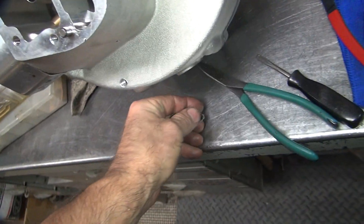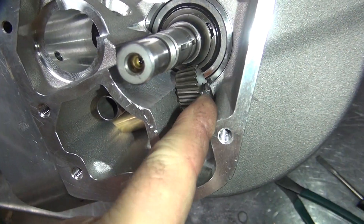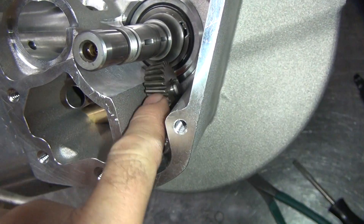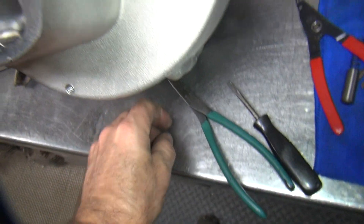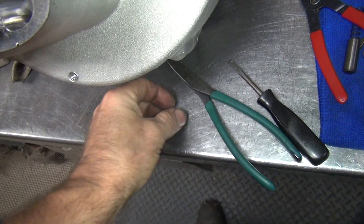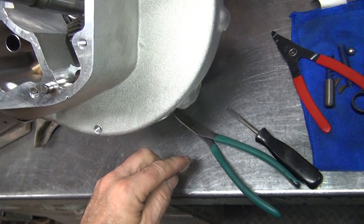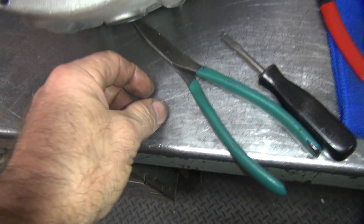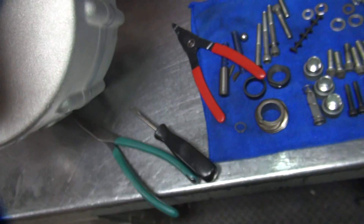So here's another clip. We're going to show so much this time. I'm going to try to put it over the top of the shaft there. We're going to rotate this 180 over. So this groove will not be what the keyway is. Now a lot of times I get this to pop on about halfway, and then I'll use my screwdriver to push it on the rest of the way. You do not want to over-expand this clip any more than you have to, because once they're overbent, they don't squeeze back and be tight on the shaft.